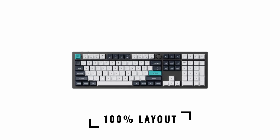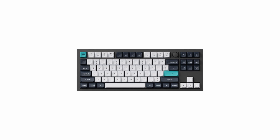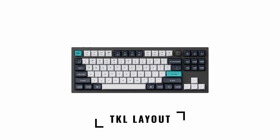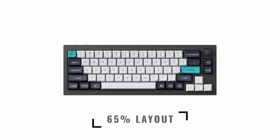Aside from the actual key layout, you've also got the keyboard size layout which comes in various sizes and shapes. The basics are: a full keyboard layout which has all the number keys, the numpad and everything. Then you get a TKL — a ten keyless layout — which is basically without the numpad. Then there are smaller options, normally like 60 or 65 percent keyboards where you lose your F-keys along the top and get a much more squished layout. Some don't even have arrow keys and you have to press a modifier like Function to turn other keys into arrow keys.